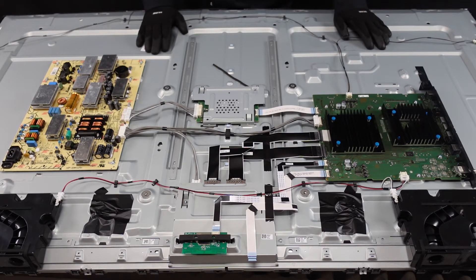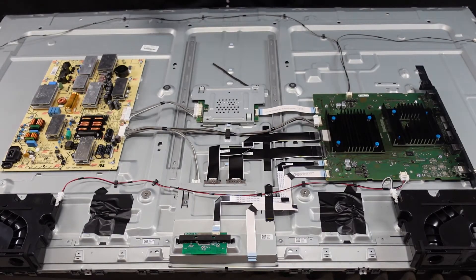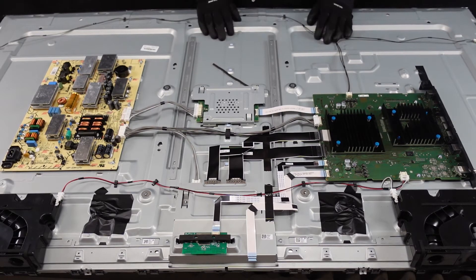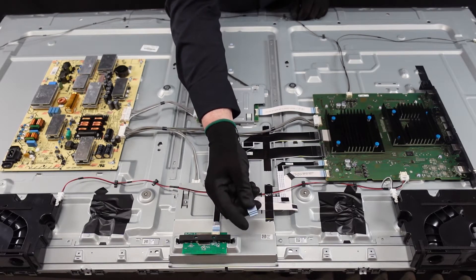There aren't really any screws — maybe three or four that go along the bottom of the bezel, and one over here where the power cord plugs in. Once you have those screws removed, getting the back off is a chore. Even using a spudger and proper technique, it is not user friendly. Once you get the back lifted up even about two inches at the top, it goes directly into the IR sensor and this just gets ripped out — there's no way around that. I believe that was more than likely intentional with this unit.